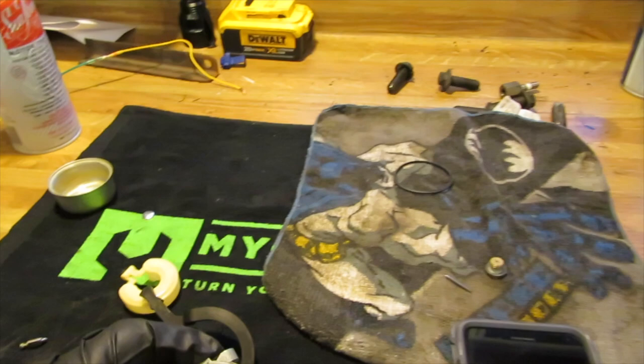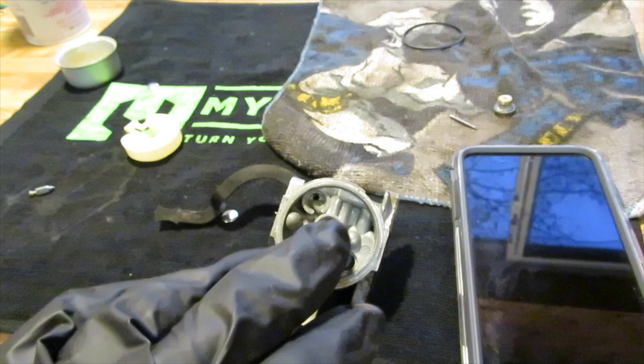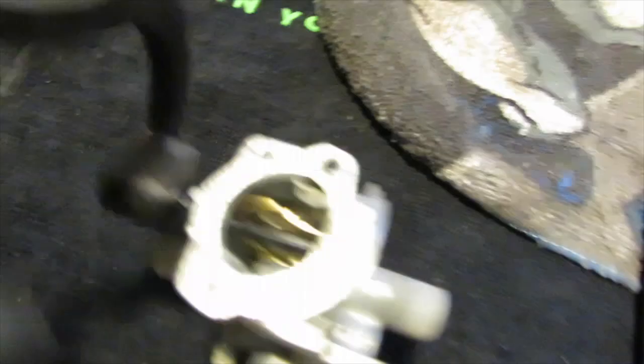Now I know you can't tell me but you can look and see. When I was doing my cleaning, I just take a small little wire — what works really well is a torch cleaner. Some of those torch cleaners are pretty abrasive, so you don't want to use the file type. Just use the smooth wire within them and run it through as you're cleaning all these orifices — whether it be in the body, there are two there, one there, and one down inside. In the bowl area there are two here and your main feed.